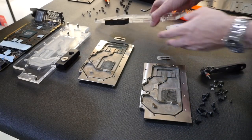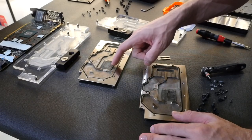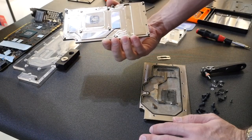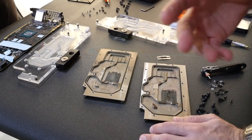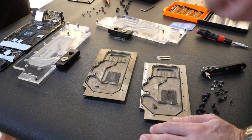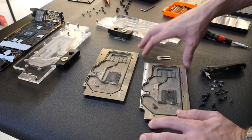The plating is pretty corroded all the way through in some places — just here that's all the way through to the copper. It's certainly not the worst we've seen, but it's seeing such a new water block, such a new installation, yet already so much corrosion. I'd say this installation is no more than six months old. I haven't seen anything like this in any of my systems in an eight year period. I've got components that are eight years old that still look almost brand new. This is something that is definitely avoidable with coolant.